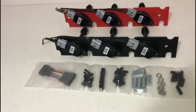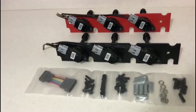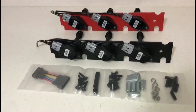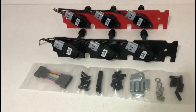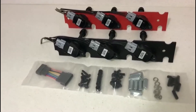These ignition coils deliver significantly more energy to your spark plugs and allow you to run a larger gap while avoiding a spark blowout at high boost levels. Luckily for us, these ignition coils are pretty well adaptable to the Z32 platform. They also use a 3-wire connector just like the Z32 and are quite easily spliced in.